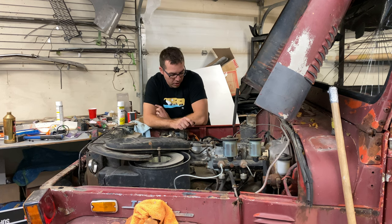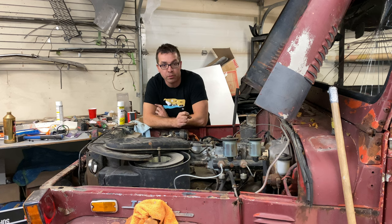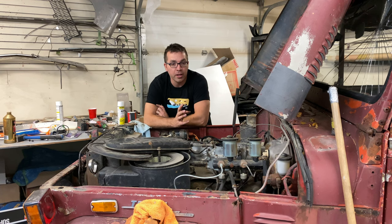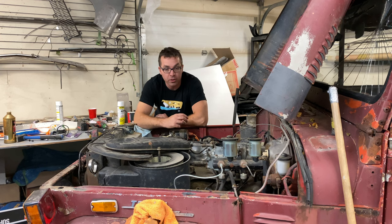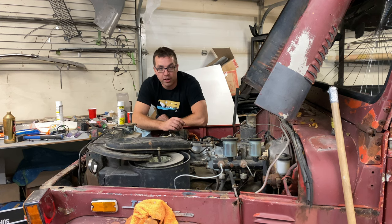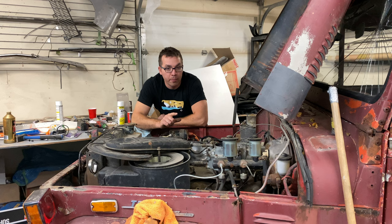That's the reason it's not starting. I have to wire up the fuel pump into the fuse block - Tony showed me a good spot for that. Right now we're going to bypass the ballast resistor in here and just run the positive wire right to the coil. It's a coil designed to not use a ballast - a generic one I got from NAPA. Tony says it'll run. So we're going to hook up the fuel pump and then look at the carburetor. It fired at one point when Tony was playing with it - it got just the right voltage and went off the carb, but no fuel pump running at that point, which is probably why it stalled.